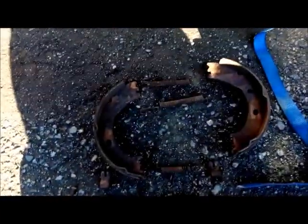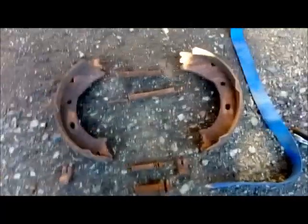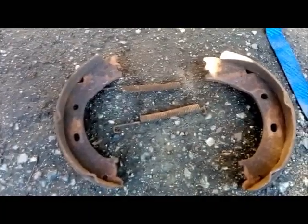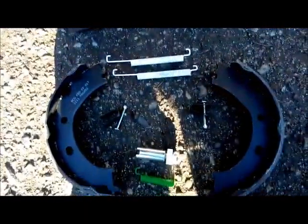So that was disassembling. Next step we'll be reassembling the new one. I purchased new pads and hardware just to keep things fresh under there. Obviously when you take it off, there's no front or back to these, but there is a top and bottom. As you can see, there's a big gap down here and the double groove. My double groove is at the top, big gap is at the bottom. I kept the orientations of the old parts and the new parts the same so I don't get confused when I put it back on.